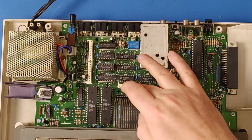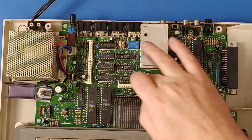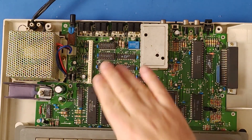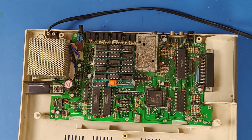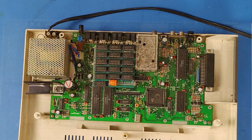Over here you've got headers surrounding four RAM chips. These four are buffer chips and these four are RAM chips. In this configuration this is 128k of RAM. Now you may find something different — this is my other Color Computer 3, and this is a 512k board plugged into the headers. The RAM chips below are taken out and all the RAM is on this satellite board. You can get more modern ones in different shapes, but they all do the same thing: they expand your memory, and you can get them bigger than 512k now.